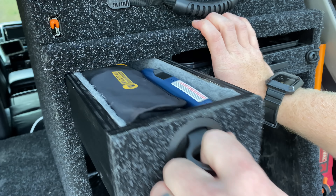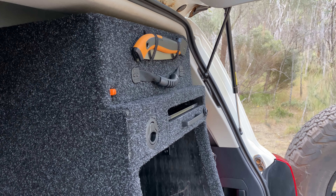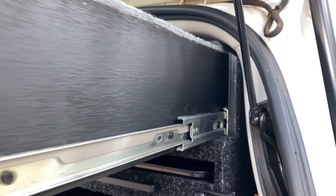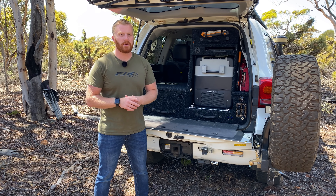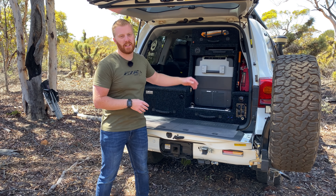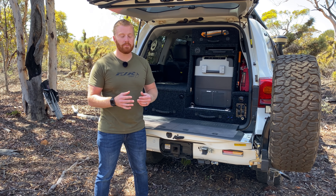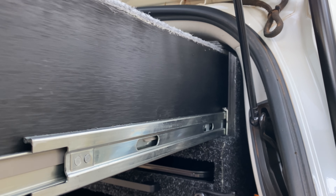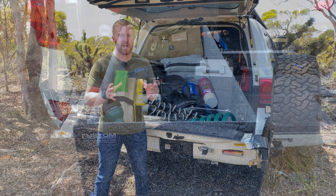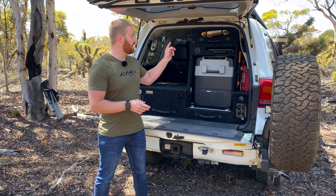The sliding tray with its wedged-type design is solid, and I installed a little elastic tab to lock it into place. I had some spare room on the side so I built a long narrow drawer just to hold cutlery and utensils, accessed with a small black pull ring locking handle. Above that is what I designed to be the kitchen drawer — slightly recessed back to allow the unit to clear the top tailgate when it's closed. The drawer runs on the same cup drawer runners as used by the Custom Installations units. The company I bought these runners from refused to sell them with only one locking tab, so I had to get the grinder out and modify the slides for a one-sided locking mechanism.